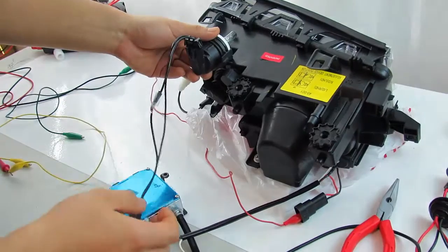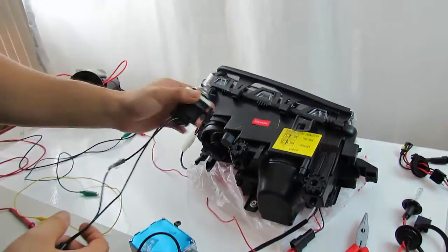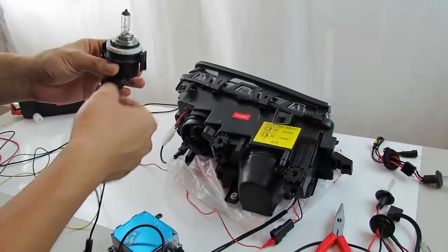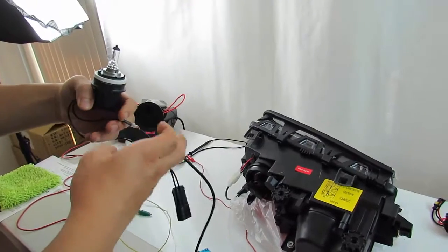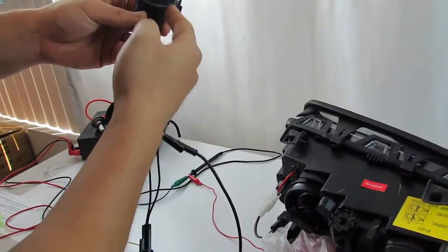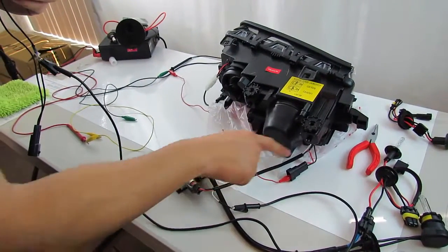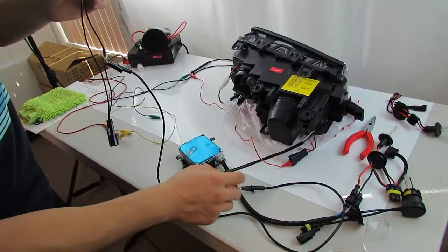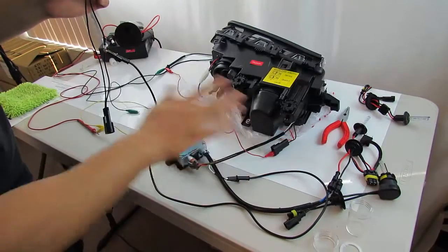Here's a key part — I need you to concentrate and make sure there's no connectivity issue between these two wires coming into contact together. Imagine this socket is already installed in your headlights; I'm using a spare as a visual reference. With this 9005 connector connected to the halogen high beam, there should be another wire joining to it. Imagine this alligator clamp as the extra wire that's braided or tapped to it — a wire stemming out that leads to this white Bi-Xenon shutter wire. This is the part where I suspect you may be losing contact. If that's the case, all it needs is some maneuvering and cleaning up of the wire to restore proper contact.